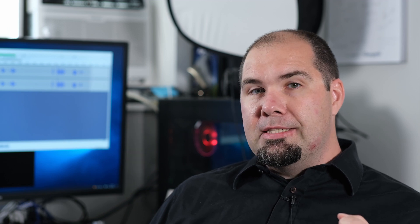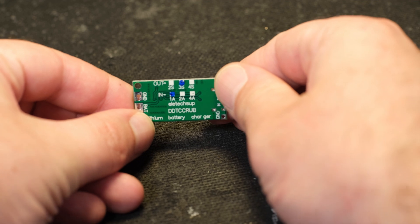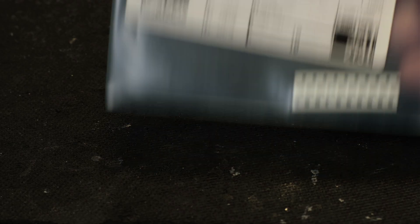So with that, I'm going to show you how to build the Microcharge 2. It's very simple - incredibly simple. We only need three parts. You're going to need a USB-C boost charger for 3S LiPo - the 1-amp one is the safest to get. You're going to need the appropriate M5-style cable, four-pin, male, and you don't want to connect around the other end, but if you have to, you have to. And a single 47 kilohm resistor. That's it. Maybe eventually I'll update this and put up a 3D-printed housing, but I haven't done one yet.